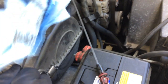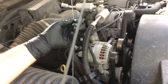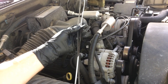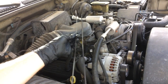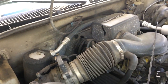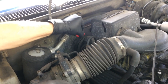Okay, I'm just going to give this a quick clean. Another thing too, when you get one of these, if you notice the new one is straight, sometimes you buy one of these, and I'll provide a link in the description where you can search for these on eBay if you want to buy one. Sometimes they'll get a little bent when shipping to fit in a box. Just make sure you get back that straight length so you'll get the right reading. What GM calls these things, they don't actually call it a dipstick, they call it a fluid level indicator. Anyway, put this guy in, we'll push him down, and now you got it.